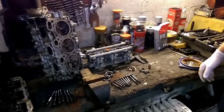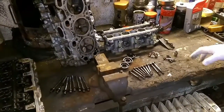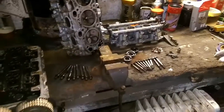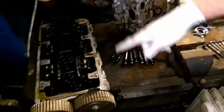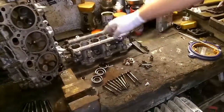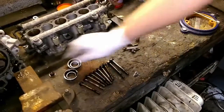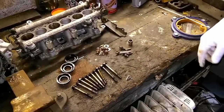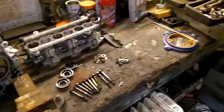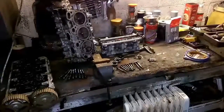We're pretty much finished. Just to show you what you end up with once you've done all of that — it's only partially torn down, done very quickly, no care for the coolant or oil. You've got your cam and all the setup with the cams, the MIVEC stuff, cylinder head bolts, cylinder head itself, intake manifold, fuel rails, spark plug boots, exhaust manifold bolts, nuts and washers, miscellaneous 10mm hardware, and then the bolts that hold the cam girdle down onto the cylinder head. So we're going to play with all this stuff, clean it up and stick it in the other engine.